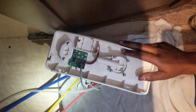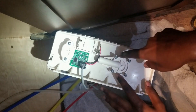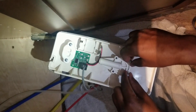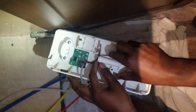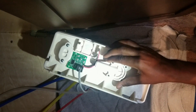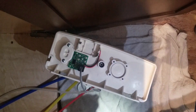This is a Kenmore Ultra Filter 300 series, but the 500 series is the same. To access the automatic shutoff assembly, unscrew the four bolts and take the unit out. It's going to be a little stuck if you're doing it for the first time, so you might have to pry it out.